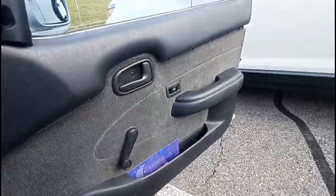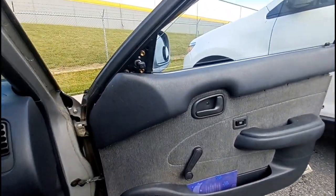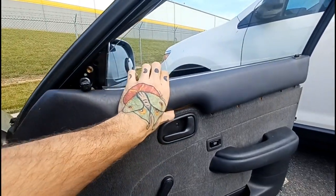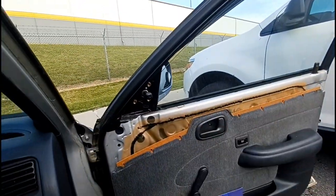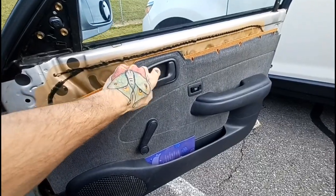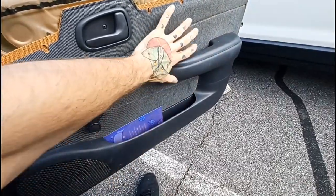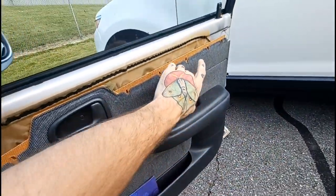The lock is on the inside of the handle, so you want to start by taking this off - I've already got it half pulled off. Get this off, and then you want to start with this screw here, get that off, and anything else that'll hang up, and then we're going to pull this whole door panel off.